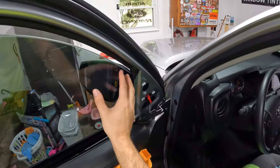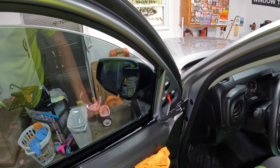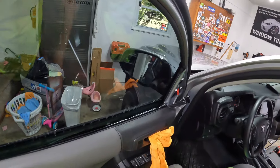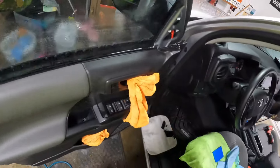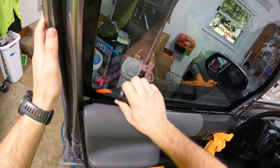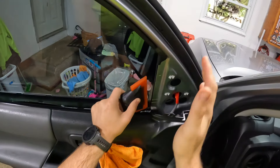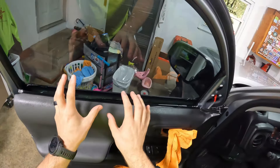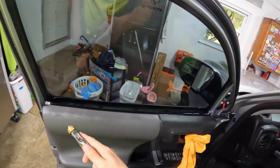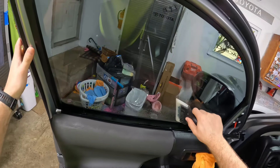I could use it to be a little bit warmer but I think we'll be okay. Let's see if we break it or if it slips — sometimes these seals are so tight they'll actually shove the film down. You can see we've got just a little bit of film to tuck below the gasket. Same principle: I'm taking the judge — a cleaning and prep squeegee — which being a soft squeegee is going to distribute the moisture real nice, and then we come back and do a little hard pass.